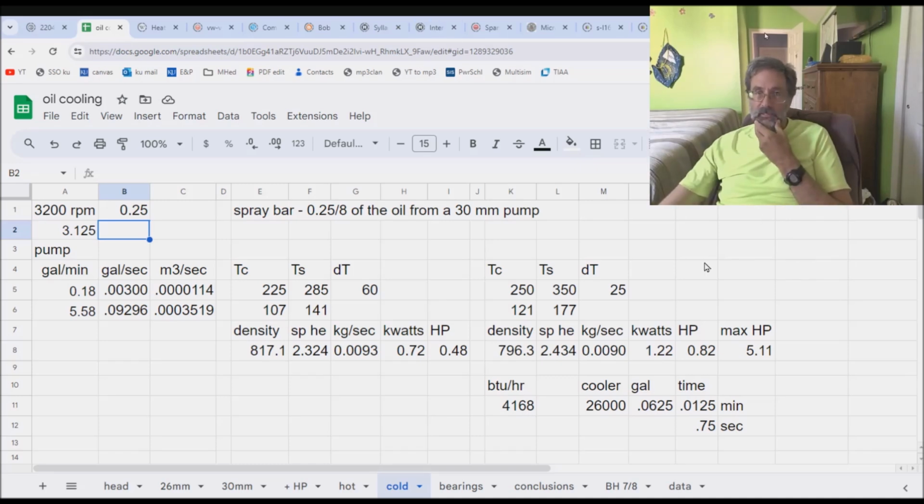And I do need to bring up and mention, once again, airplane. I know a bunch of people who watch these videos are airplane guys. RevMaster is the king. Not Bob Hoover. You go and you look at what RevMaster does with their engines. They got a 2.3, the RevMaster 2300. No swivel feet. Not Hoover modded. No spray bars. Doesn't even have the rod notch modification.